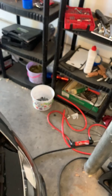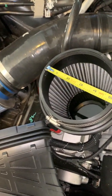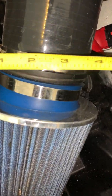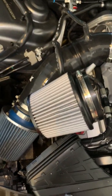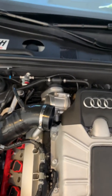I bought the IE filter — this is how big the filter is. I think it comes with the intake, but I just bought the filter separately. This is a huge five inch... actually I think this is only a four inch. Yeah, this is a four inch, so this will not fit on that. I'm still going to buy the intake from IE so it'll really be breathing. So if you get the 80 millimeter throttle body, make sure you've got an intake to match it if you buy from IE, Integrated Engineering.